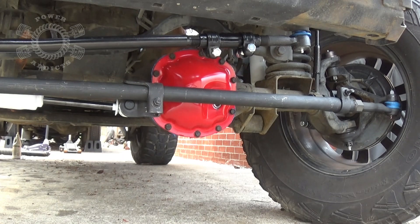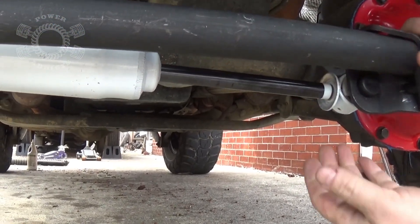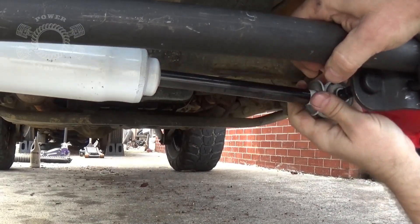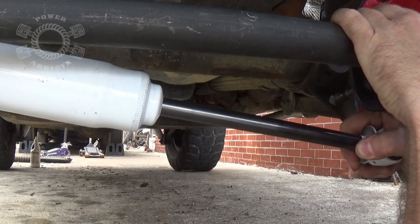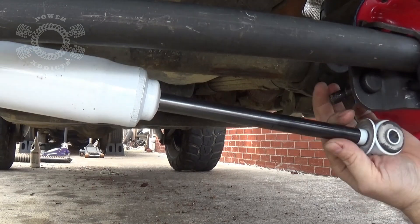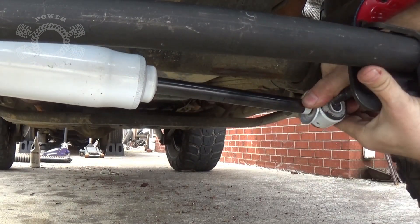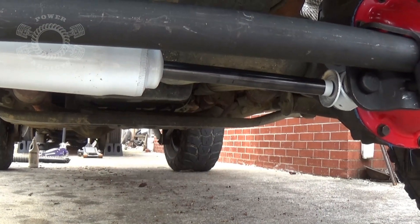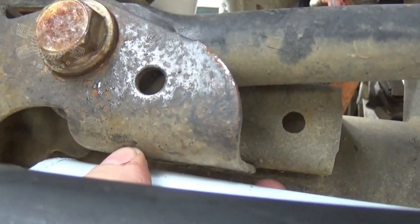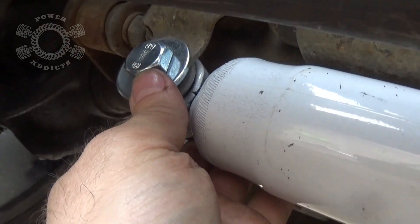Okay, I've turned hard driver right there. Let's crawl under and check some things. First thing I want to check is the extension on this — grab hold of it and take it off. Do I have to pull it out anymore? Nope, I still got plenty of travel on that, so I'm not overextending the steering stabilizer. Push it back in, put that back in place, slide that back on, now check our gap over there.